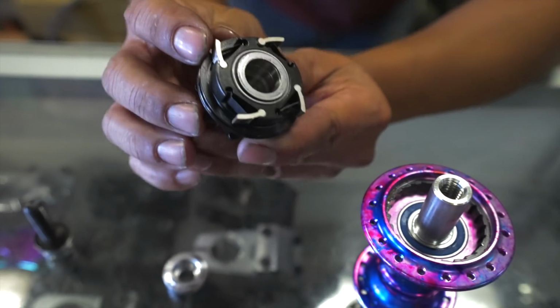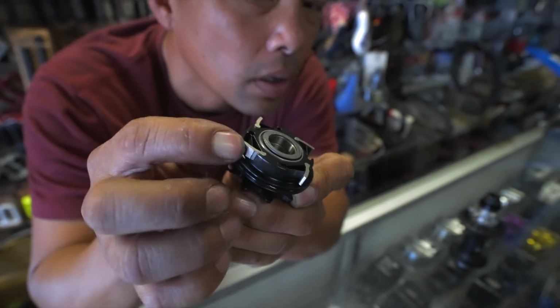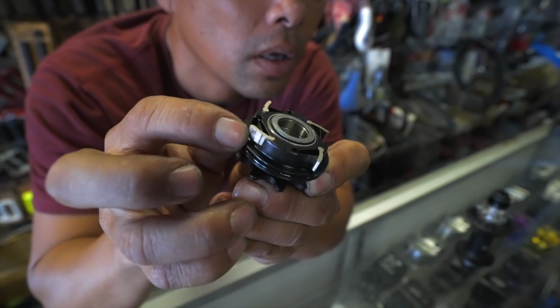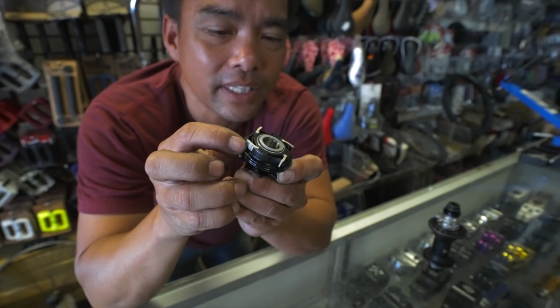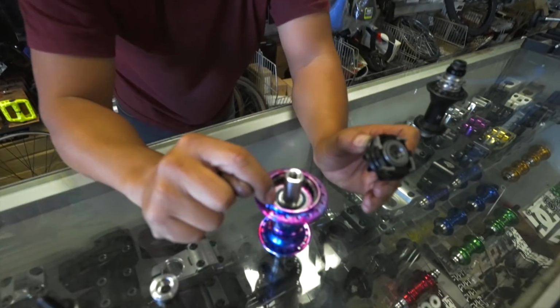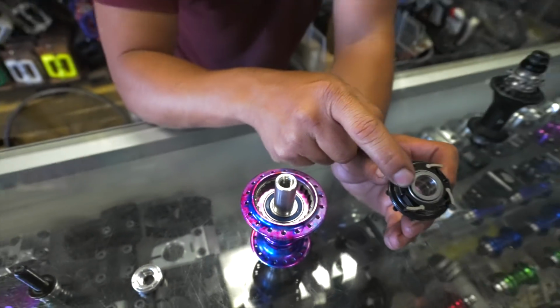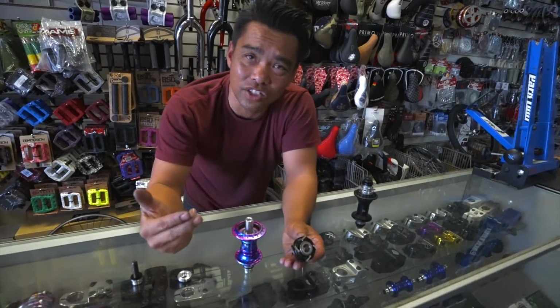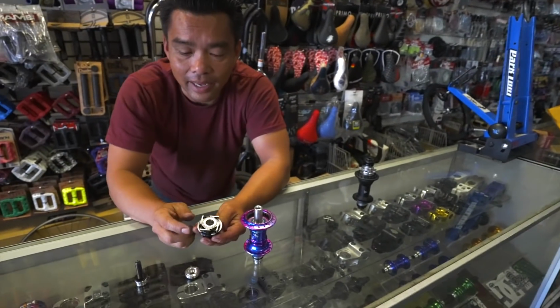So if you could hear it carefully, let's put on the mic. Can you hear that? So now imagine every single time this thing goes down and it pings back up and it hits that shell. That's what causes the pinging that you hear. The little ratchet pinging that gets all you men aroused, you know? It's all this.